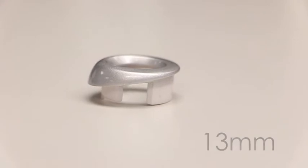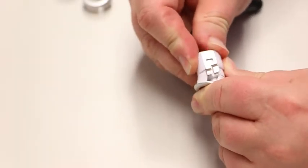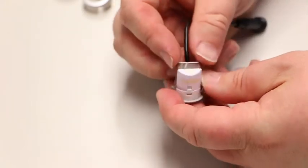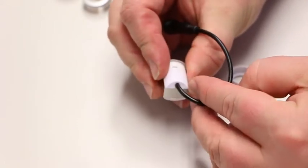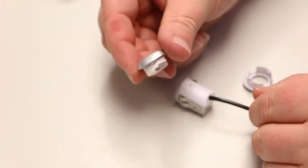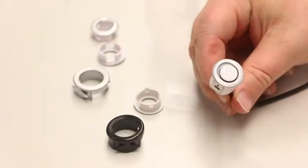These rings are very easily changed over by simply clicking the tab on the bottom of the sensor head and replacing with the larger angle. This has a divot on the top to show the top — it's clicked at the bottom first and then slid over the head until you hear the firm click. The parking sensor heads are all marked on the back with an arrow and 'up'. In the situation where a plastic bumper has an extremely large angle falling away and the 13-degree parking sensor head is not enough to counter that, it can be coupled with a 6-degree insert to give a combined angle of over 20 degrees to combat that large angle.